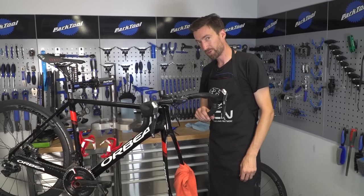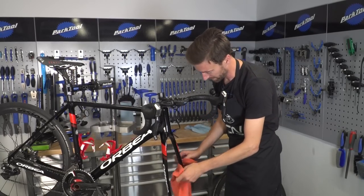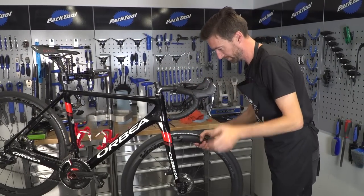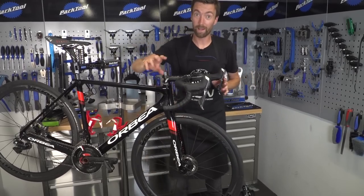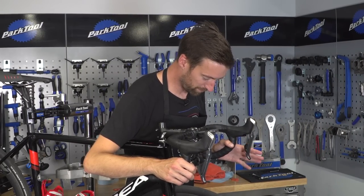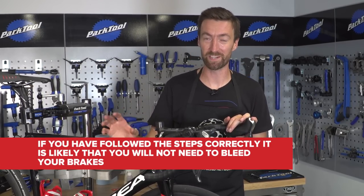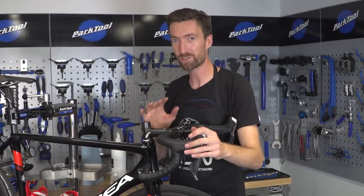The job is probably done if you've been careful and not lost much fluid. Take the rag off from around the caliper, take the travel spacer out, and replace the front wheel. Testing the brakes: the front brake is now on the left and working very smoothly. The rear brake, not so smooth. We'll go through the next steps, which should hopefully solve this problem.